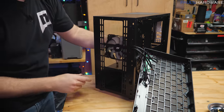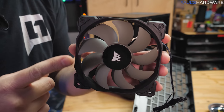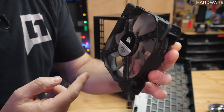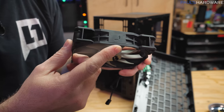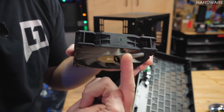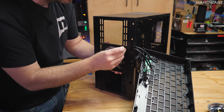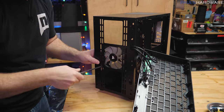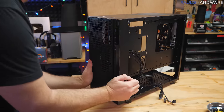I'm going to set the front panel aside gently so I can take my fan and pop it on here in the front. Keep in mind with fans that the airflow is directional — usually the bracket is where the exhaust comes out, so since the bracket's there, the air is going to come this way, meaning this is the intake side. Some fans are nice and put arrows on the side indicating which way the fan's going to spin and which way the air will flow. If you buy your own extra fan, it should come with its own little fan screws — these are slightly different than the rest of the screws in your system, so remember to use the fan screws that came with your fan. The front panel pops back on in pretty much the same way.